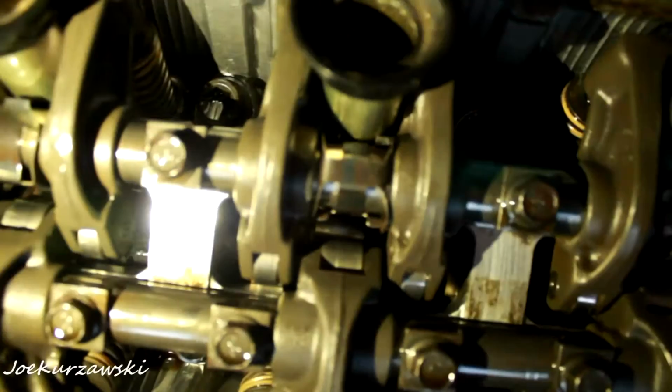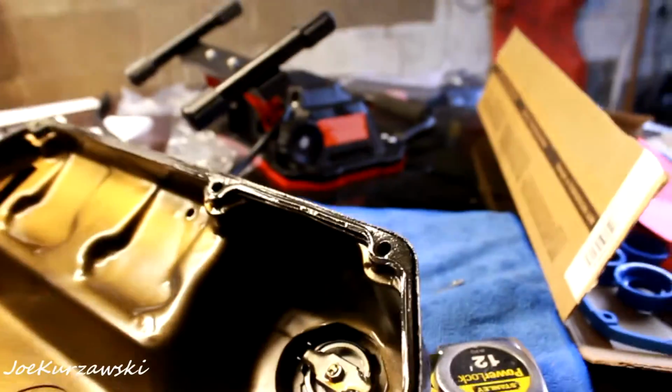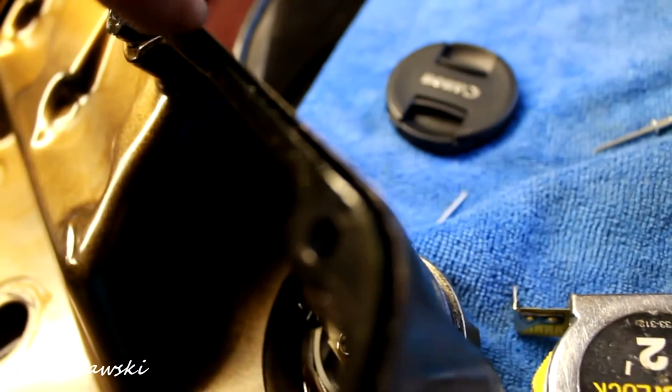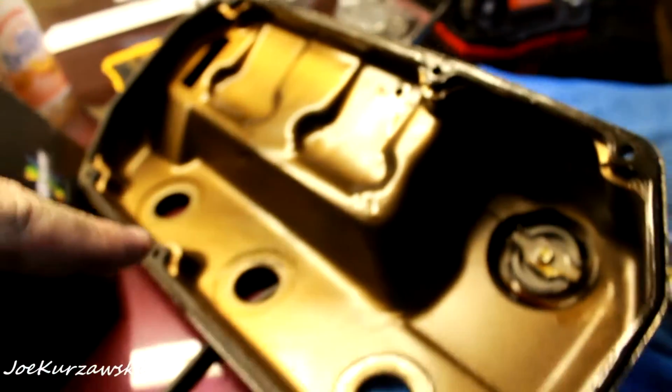Alright, so I had to spare one of these little spacer clip guys for the rocker arms. Put him in there, and there's the oil passageway, nice and open. Everything's looking kosher here. I'll have to clean up that surface and pull off those tubes, move the cover up here. As you can see, it was leaking all along the front here, so I will pull this off, put in the new one, and then put our new tubies on.